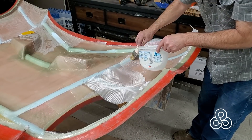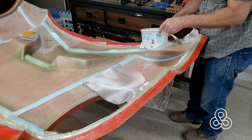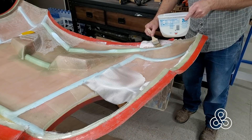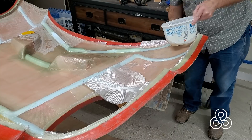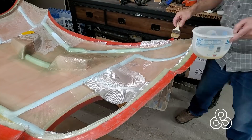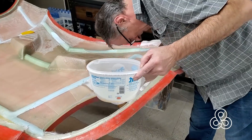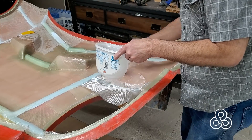We'll keep adding larger sheets to go around. Most of this lamination was three layers in the fender area. Going where the tire's going to be, there were four layers, and actually five around the little turn-back, because I really want to build up the lip where the tire will be - in case the bump stops and suspension didn't quite catch it and it went up and hit the bodywork. That's where it would be. We need some strength in there for rock chip throws and things like that as well, so strengthened up there to about five layers.